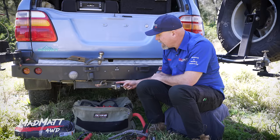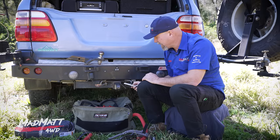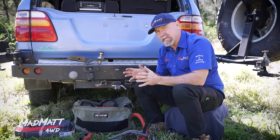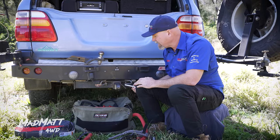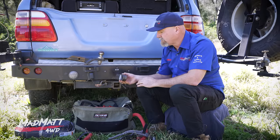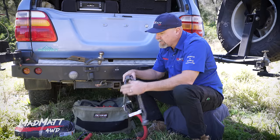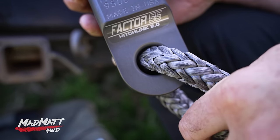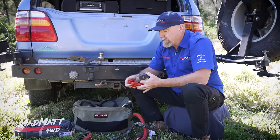The reason this hitch receiver is good for the job: when it's in the hitch, the pin comes through in true double shear. For this to come out of the receiver it literally has to cut the pin clean through — the force required is massive. If you're doing kinetic recoveries safely, which are the highest-energy vehicle recovery method, this pin is not going to fail when attached into your receiver. Additionally, this particular hitch receiver is designed for soft shackles — it has a nice radius on the inside that addresses the bend radius concern I mentioned earlier.